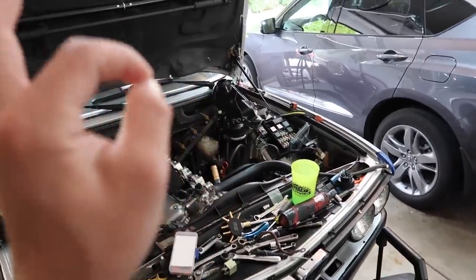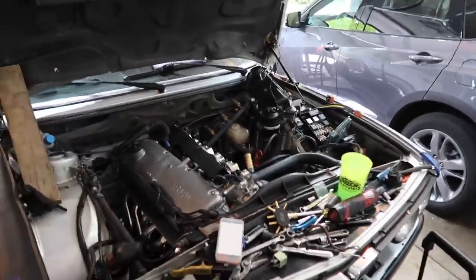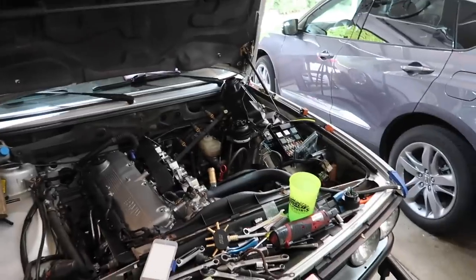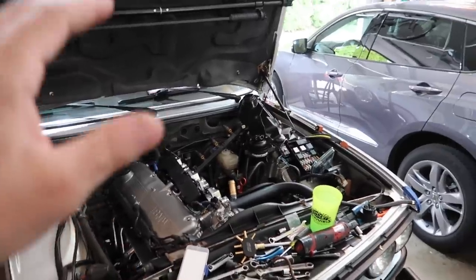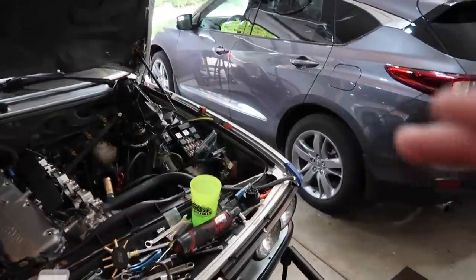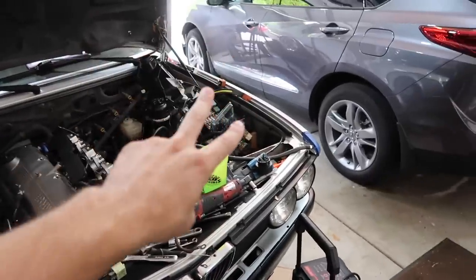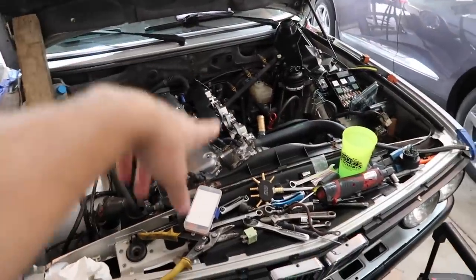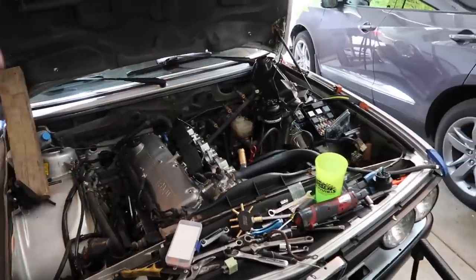I have been chasing my tail like a maniac trying to understand what is wrong with this car. Something with the wiring, something with the ECU. I've tried crank sensors. It has been brutal and I have not understood. I've gone through 5 main relays out of nearly all my personal cars in my stash. Still nothing. Pins 87 in the relay were not working. When I would jump to pin 87s, I would get the ICV, I would get voltage, and I still don't think I would get crank or fuel or spark.